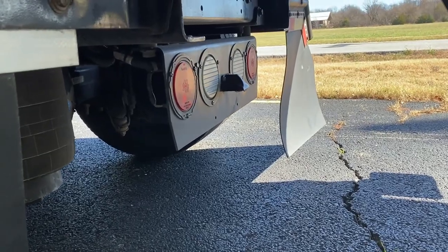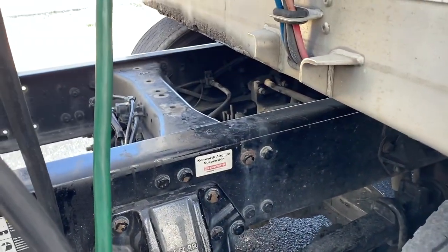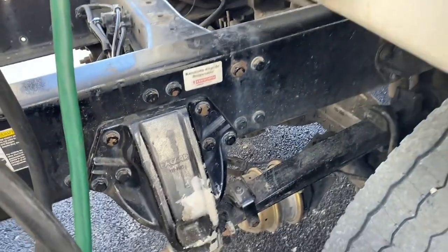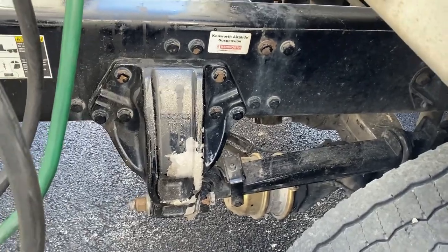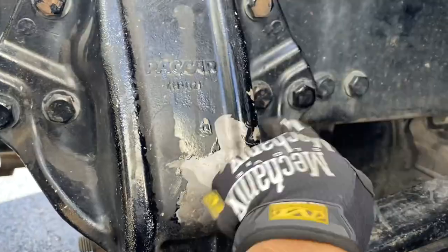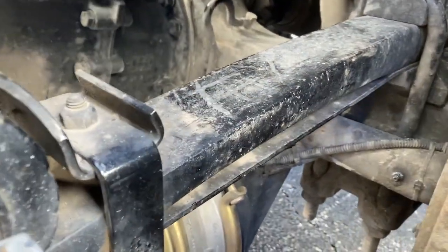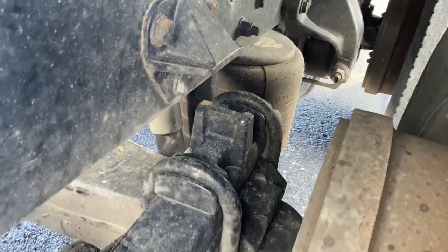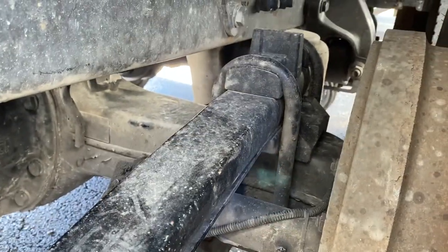Now I move back over to start what becomes kind of the repetitive side of doing this pre-trip inspection. Everything — all the systems — kind of work the same with some exceptions. Starting with the suspension mounts again — all bolts are secured in place, none are missing, not bent or cracked. Then moving to the leaf springs — bolted securely at the top and back, bolts are in place and not missing, the actual springs themselves are not bent, cracked, or broken, properly aligned, and secured with two U-bolts that are not missing any bolts, mounted securely.